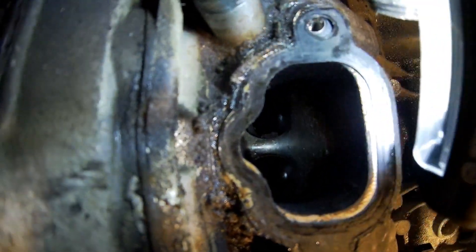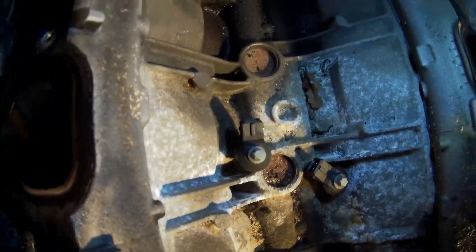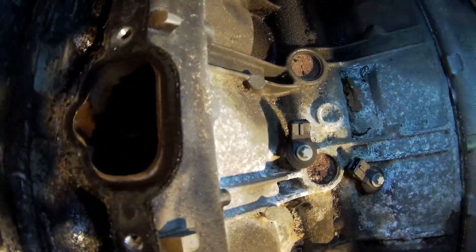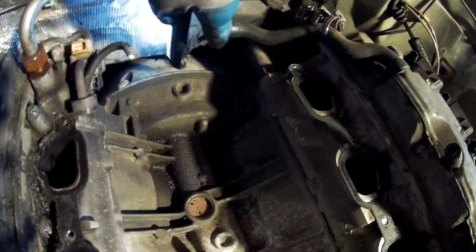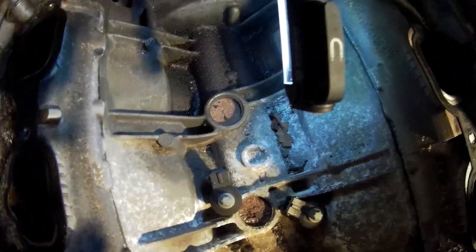This is why you should also be very careful. I think you can see on the top valve there is some dirt that just fell into it. That's why I should not move anything and first clean everything out — just to be sure. You can also see what I mean about the knock sensors being in a very, very difficult place. So this is a very tricky job. What I'm going to do is move the cable out and lengthen it, making another connector so you can reach and always disconnect them, because the wiring loom is connected underneath the intake runner.